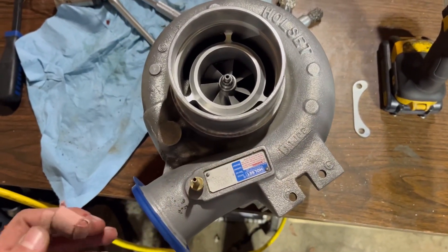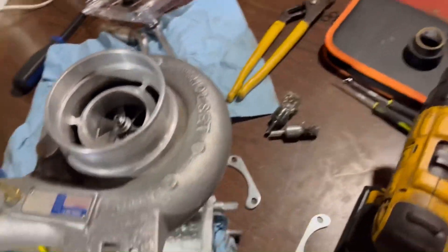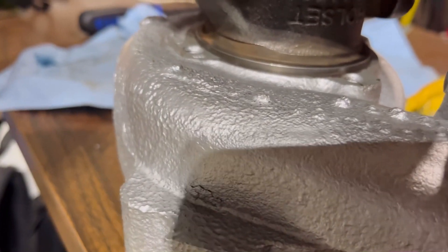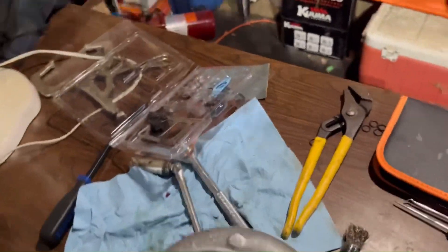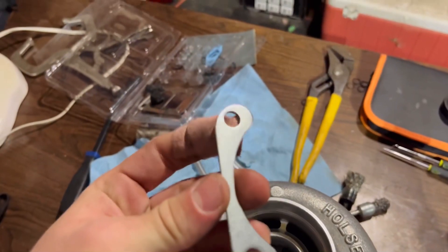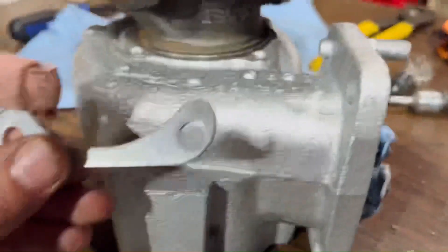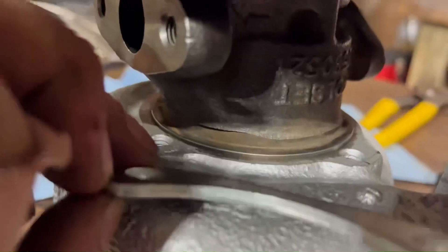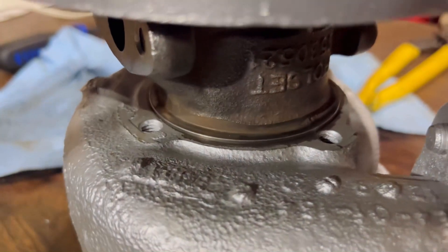For those using the HX35 for a Cummins, the compressor outlet is here, and then diagonally this is the exhaust outlet. Basically just slides into there — make sure it's sitting flush all the way around. Then you're going to take these brackets — they do come with the kit, but you could reuse the old ones. They line up with the holes on the side here. The bracket sits right on that part of the housing — there's a little lip there, and that's what prevents this from backing out.